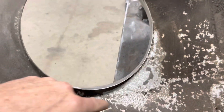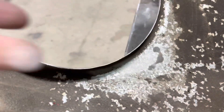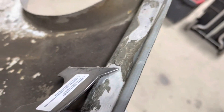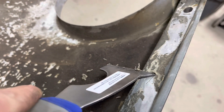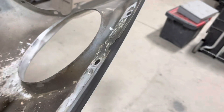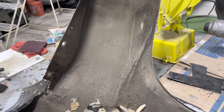I want you to see the corrosion that is going on — this corrosion will be cut down in its tracks when I blast. Part of what I'm doing is just cleaning up some of this superfluous junk: sealants, body caulking, pliable gasket stuff. It's always better to get this stuff off prior to blasting because otherwise I'll just waste time and fill the dust collector with this kind of material.